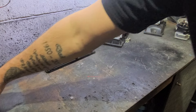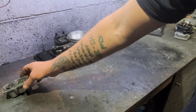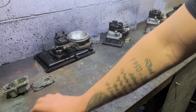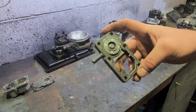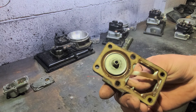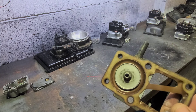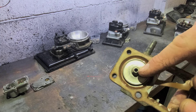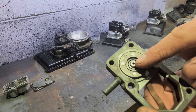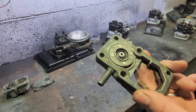So we've pulled our one regulator apart and you're left with something like this — that's the entire bit. We don't need the back casing. What we do need is this bit — this is the bit that's broken. On the back we can see a 30-year-old diaphragm. This is your main diaphragm, the darker circle, and this is where you do your warm-up regulator adjustment. On the flip side, that's the other side of the pin. Now there's a diaphragm here, and the other diaphragm is inside here.